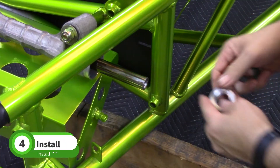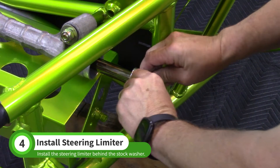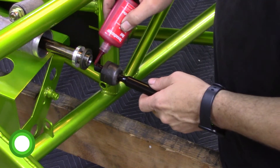Remove the washer from the rack and install the limiter. The cup side of the limiter should go toward the rack. Slide the washer on after the limiter. Apply red threadlocker to the rack threads and to the tie rod.